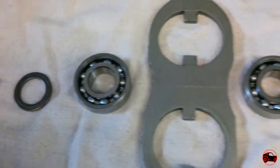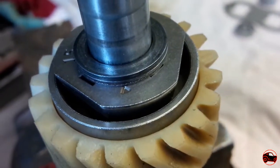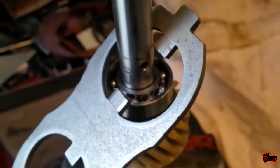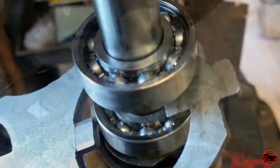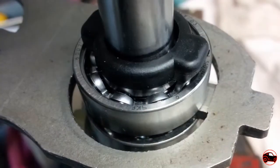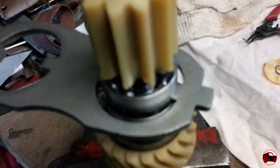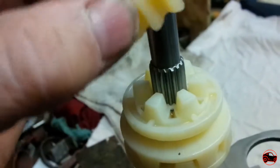Later when I received my new parts I began to reassemble the transmission. To ease the job I cleaned all the parts and kept them in assembly order. The first group to assemble was the one with two ball bearings and the clutch lever. To insert the locking pin in the shaft I centered the lever and carefully compressed the parts together to hold it. After, it was the long gear on top of the locking pin cap. Then the clutch and the reverse gear assembly were put together and were ready to be positioned in the housing.